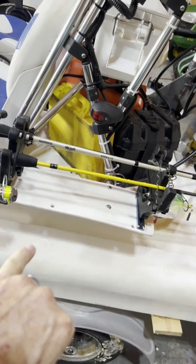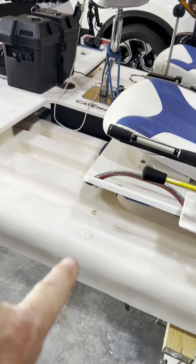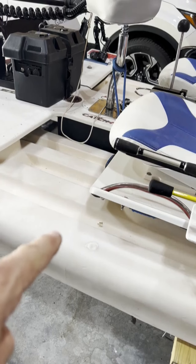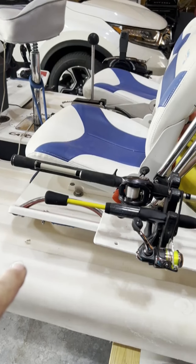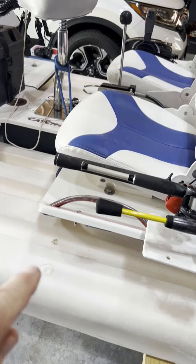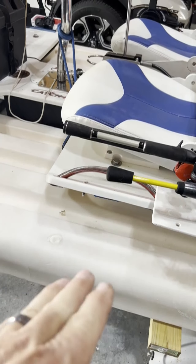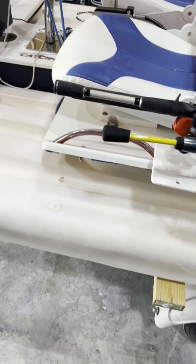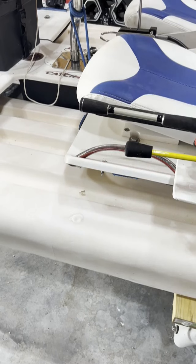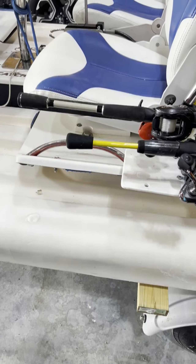From right here all the way up to here there was no foam on this whole side, so I drilled three more holes. I started pouring foam in the back one, then this one, then the last one up here to finish it off — I already had foam in that front area. I filled up the whole side. To cap the holes I used little plastic caps and then JB Weld plastic on top, but when it dried it came out rough and wavy, so I sanded it down and went back over it with E6000. E6000 is waterproof, handles vibration, and gasoline won't mess with it.